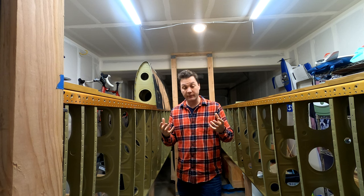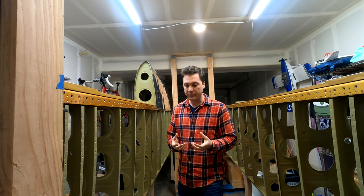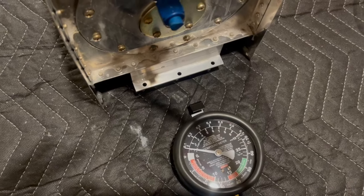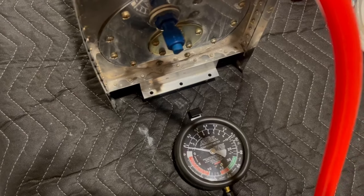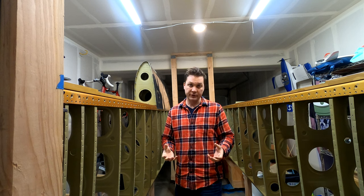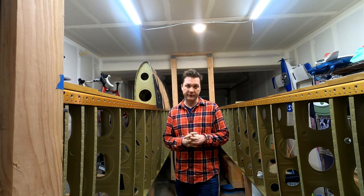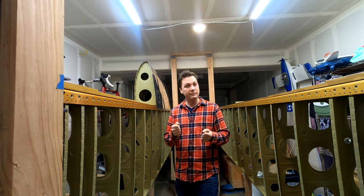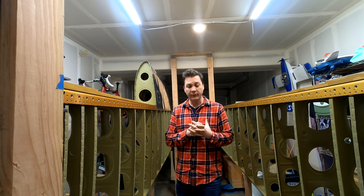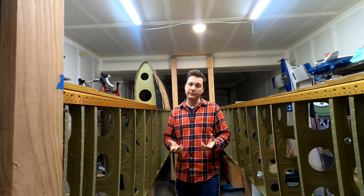I did pick up some great diagnostic tools while testing the tank — all from my love-to-hate-it cheap tool store. If you're sick and tired of those balloons, they have a vacuum/pressure gauge that works really well. There are instances when fixing leaks where you want to create a vacuum in the tank, whether to suck some sealant in or other reasons. Be aware: the reason we use balloons is because they'll pop before your tank does, and that gauge will not — so you can generate way too much pressure or vacuum, and you've got to monitor it carefully. Another cheap tool I picked up was a hand pump that pulls a vacuum as well as adds pressure — an in-and-out type pump. If you're dealing with tank leaks or testing, I suggest spending a couple of bucks and getting those tools.